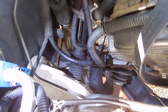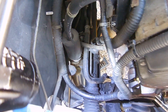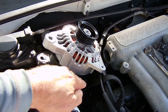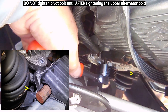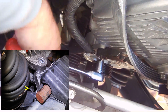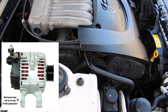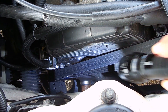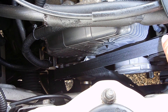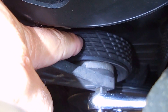You can see the area is now nice and clear where the alternator was. Take the new alternator and very carefully work it all the way down to where the old one was mounted. Insert the larger pivot bolt first, ensuring that the square head of the bolt is seated properly on the alternator. Then install and tighten down securely the top bolt. When you reinstall the belt, make sure the belt is exactly in position on the pulley and not hanging off. Also make sure the belt is not frayed, cracking, or feeling really dry or glossy — if so, you'll definitely want to swap that belt out.